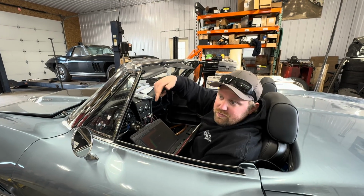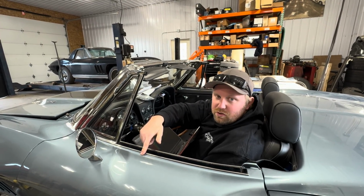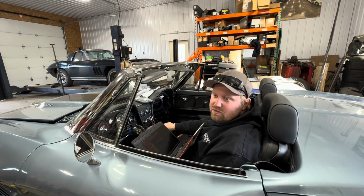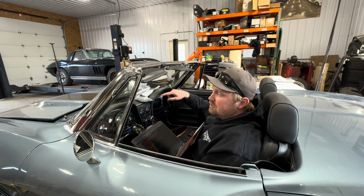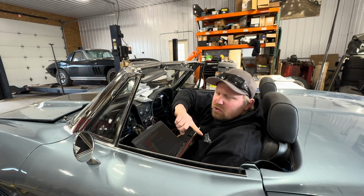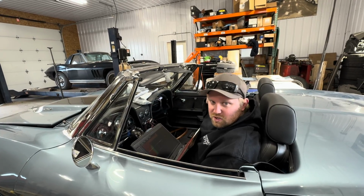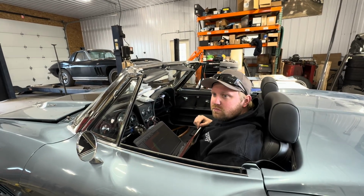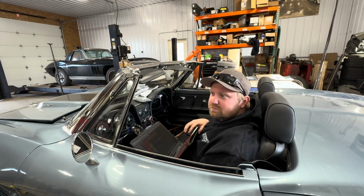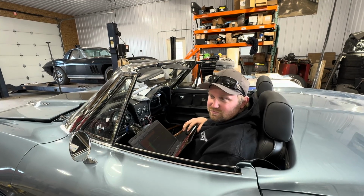And these side pipes aren't original side pipes. These are like what we do on our race cars. So it's got 2 different style mufflers, 2.5 inch. It goes 3 inch into the cutout, then 2.5. But the exhaust on the car, the full exhaust, is also 2.5. So yeah, 517 naturally aspirated LS. Should be fun. Now we've got to get it to not wheel hop, which I think I fixed, and it'll be a fun car.